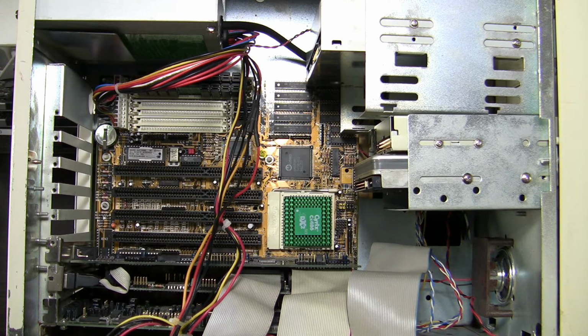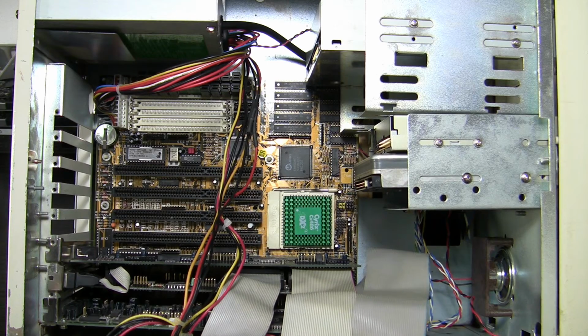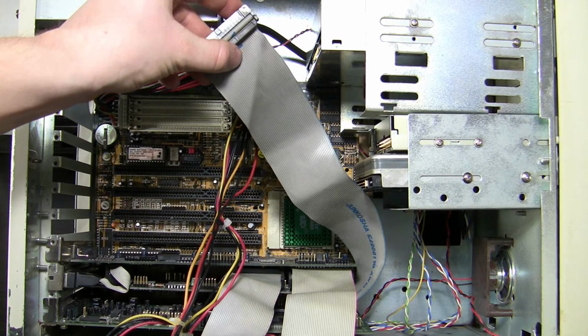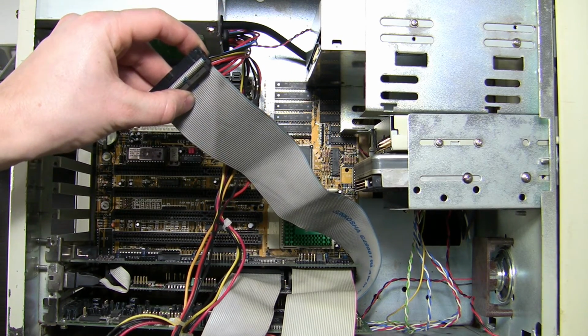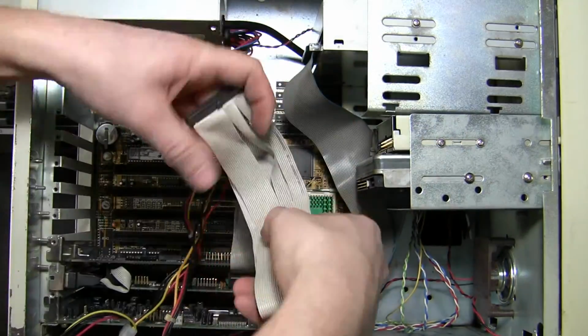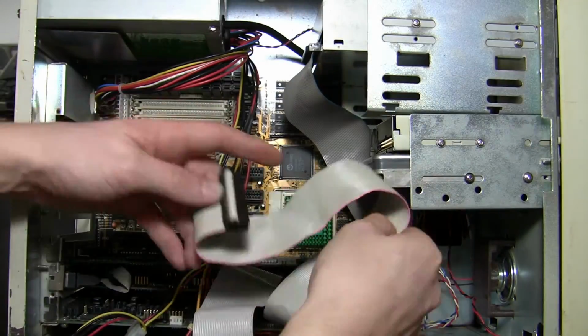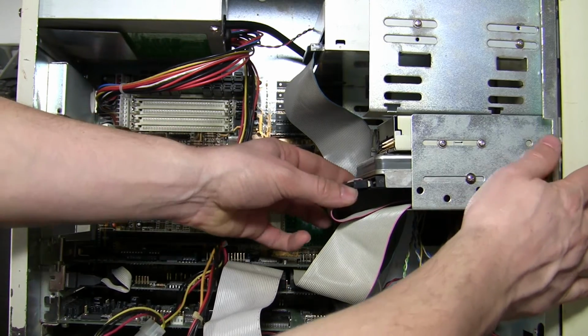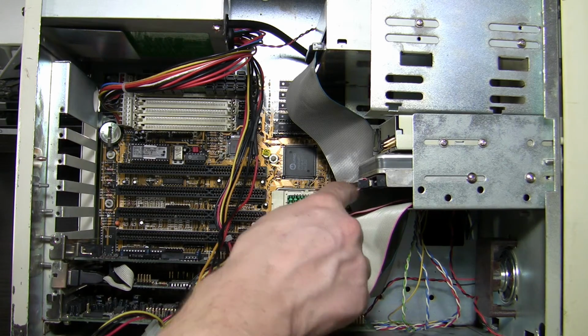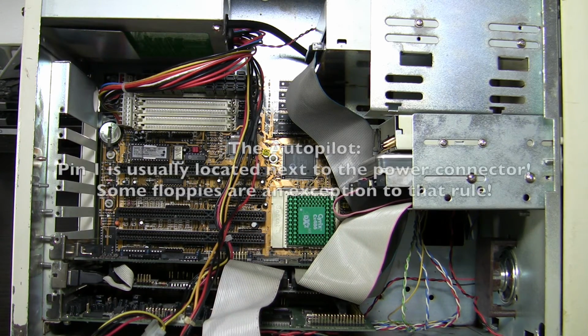We have come to my least favorite part of the job, guys, cable managing this madness. Wish me luck. I'm gonna start with the CD-ROM, and I'm gonna use this cable, which is named Junkosha. Probably comes from junk, have no idea. Remember how I told you? Usually the signaling wire, the red one, shows us where pin 1 is from the power supply. Not always though.